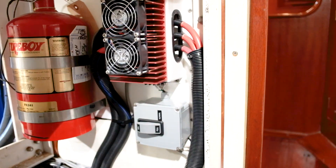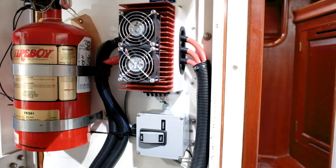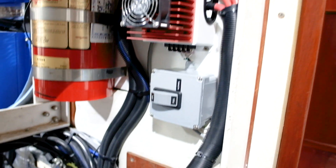And that gets hooked up to this external rectifier here. The reason for all of this is basically by pulling the rectifier out of the alternator, you can greatly reduce the amount of heat that the alternator makes, therefore increasing the amount of power you can get out of it before you overload it thermally.